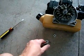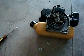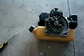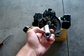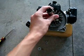I'm going to show you guys how to mount a socket to a weed eater motor to use it as a spindle for a motorized bike — friction driven obviously. This is a 3/4-inch long socket. You just got to make sure that it will go over your crankshaft. The reason for not using a peg is because it won't sit flush in between the two pull starter springs.